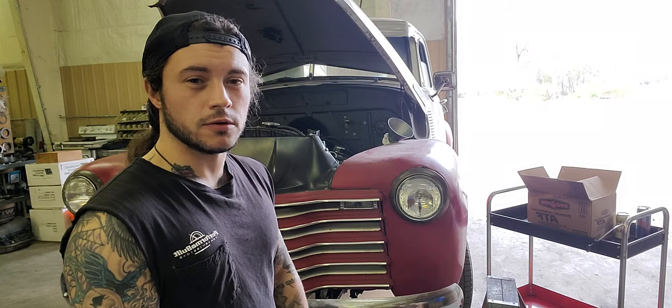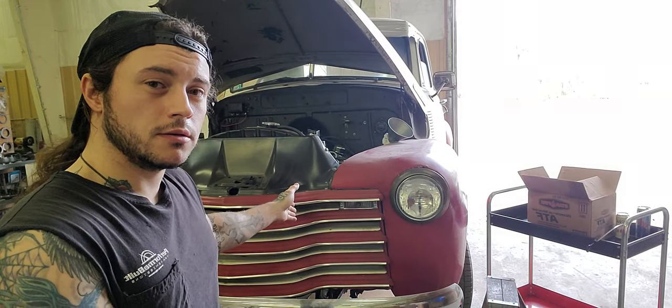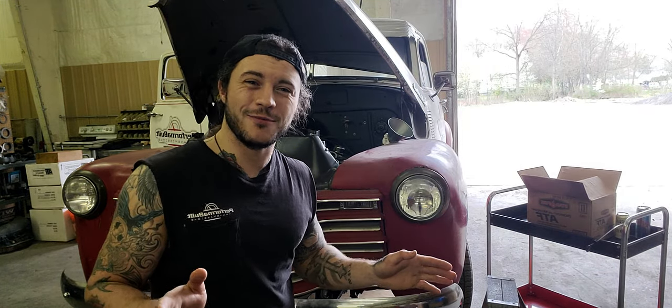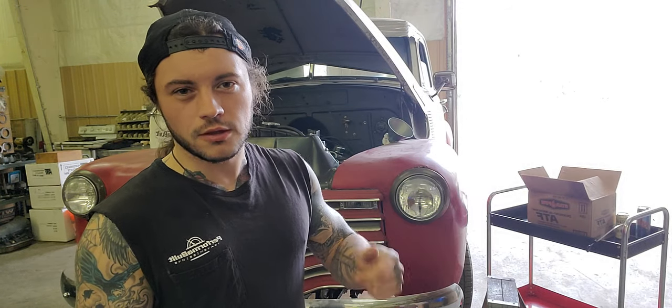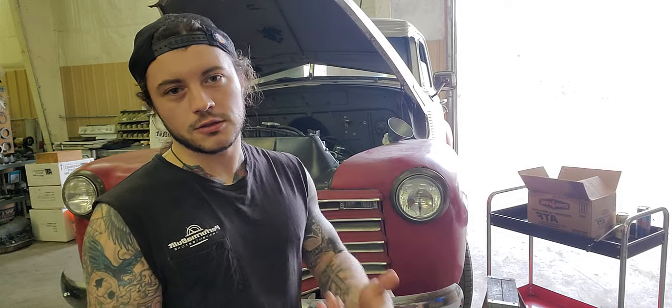And it has always been pink and it has always worked so good, and it saved me a buttload of money. Because frankly, this particular transmission and even the 4L80 doesn't really care what fluid. It's not going to make or break your unit. What these care about is an on-time service and the filter change. The filter change matters more than your fluid, okay? I can't stress that enough.